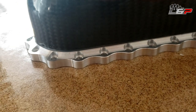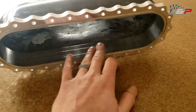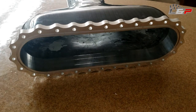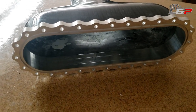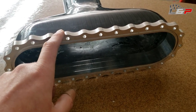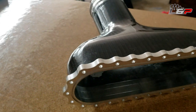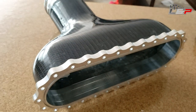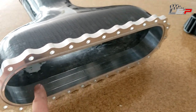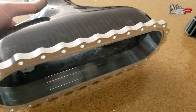We did have a little bit of excitement when we were machining the inside pocket out. When we were doing that, obviously it relieves a lot of the strength of the part between the vises. And we were paying close attention to it because we knew it was a concern, but right at the end when it was going on the roughing pass of this outside, the part just walked out of the vise slightly and we stopped it and caught it. And just re-indicated everything back in, took a much lighter cut, and then we also got some steel and put it between the inside. That's why this inside piece does not have a finishing pass on it, but you're never gonna see it, and only air flows through there, so it's fine.